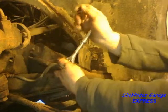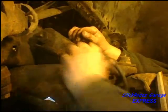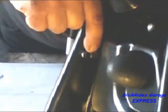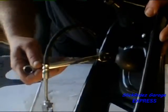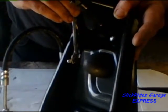Once the nut and bolts are removed, I'll lift the bracket and hose straight up to free the mounting tab. Here's a tip: the brake hose bracket mounting tab blocks access to the brake hose bracket bolt from underneath the control arm. A box end wrench won't fit between the head of the bolt and tab, so I'll use an open end wrench from the outboard side of the control arm to hold the bolt and remove the nut.